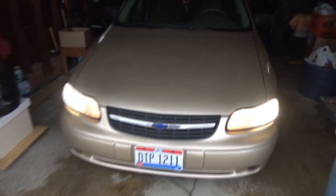Now that the oil is changed and it's running good and sounds good, I'm going to show you guys what else we're dealing with. As you can see the headlights are on. If you watched the vlog a couple videos ago you'll see that we have the right tail lamp working with the regular lights, but the left side we get nothing. What happened is years ago water got into this tail light and completely corroded the circuit panel where all the bulbs go. I ordered a new circuit panel a couple weeks ago and put it in.